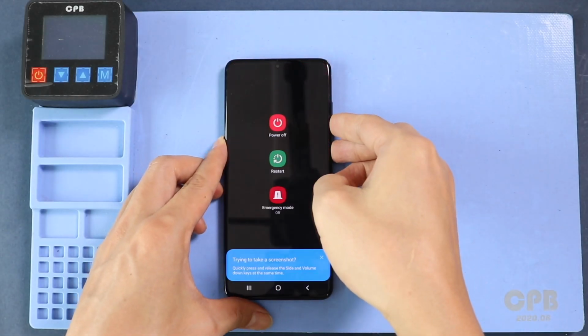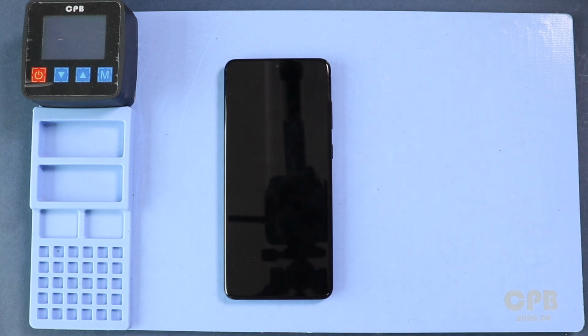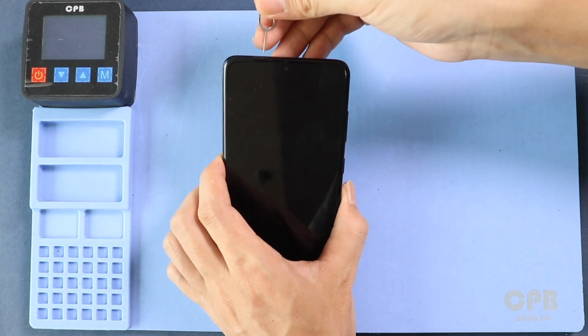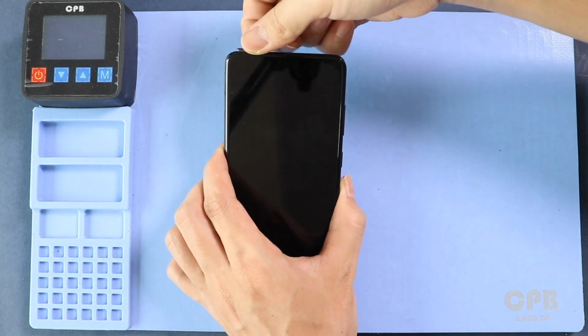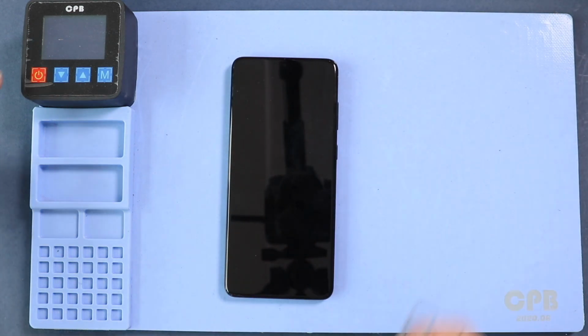Today we will show you how to replace the LCD assembly on the Samsung Galaxy S20 Plus mobile phone. To start, we need to have the right tools to proceed with the repair, which you can find in the description. This replacement guide is based on the LCD assembly with frame installed. First, take out the SIM tray and then remove the back cover.